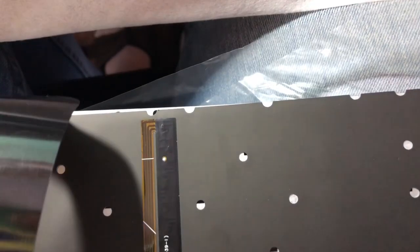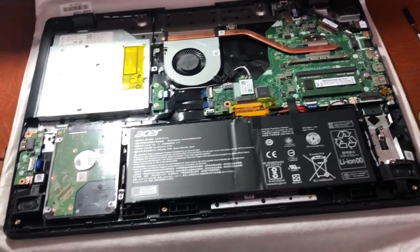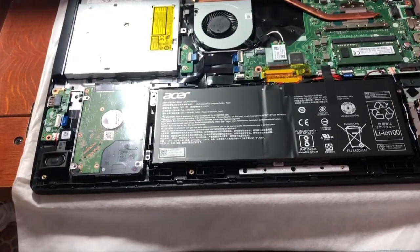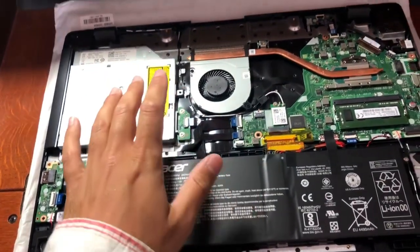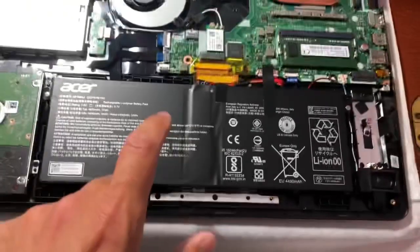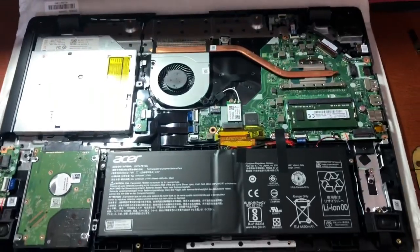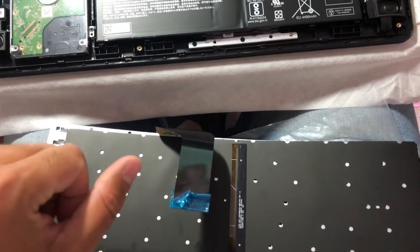So this computer has the option to upgrade the keyboard with backlight, because these didn't come from factory with backlight. That's a plus. And I guess this requires taking the whole thing apart. Gotta take out the hard drive, the battery, the DVD optical drive, all the USBs outside, the Wi-Fi, right? And the touchpad. The motherboard has to come off. I have to unplug the screen. Everything has to literally come apart just to install this backlight keyboard.